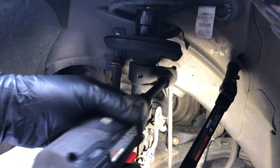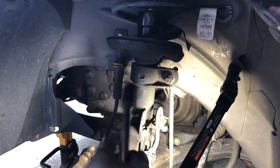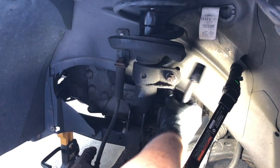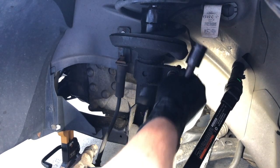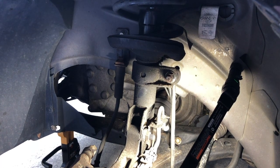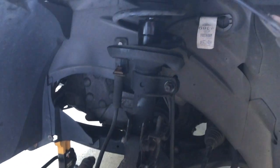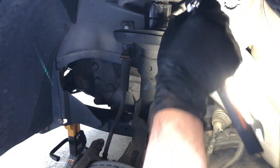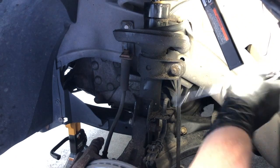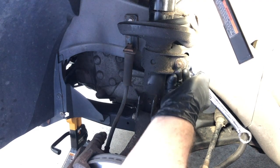What will often happen on these old ones is it'll come off part way, and then you'll get a situation where this stud is just spinning. That's part of why this is all worn out. What you have to be able to do is get in the back — there are some little flats you can get a wrench on, 17 millimeter, typically with these genuine GM stabilizer bars. We can get this guy right in the back here, and when I get this off I'll be able to show you what I'm doing.